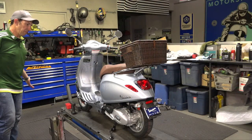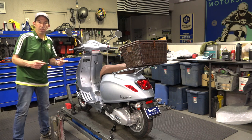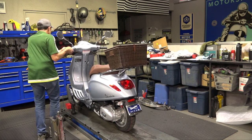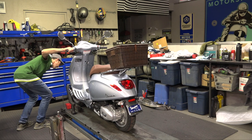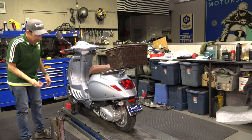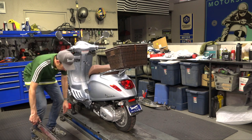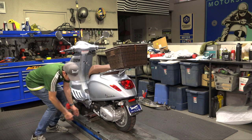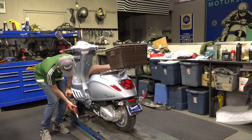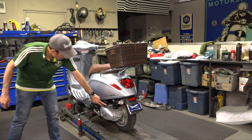I'm going to make the job easy with a lift that clamps the front wheel. If you're doing this at home, check the ScooterWest scissor lift videos — I also show how to make a platform to chock the front tire in past videos. The way this works: I clamp the front tire and the scooter stands on its own without the center stand. I'll put a scissor lift with a rubber pad right underneath the frame and take just enough pressure so I can remove the entire bracket.